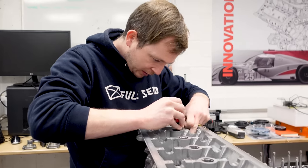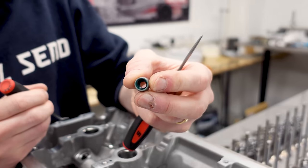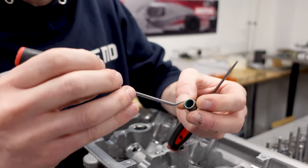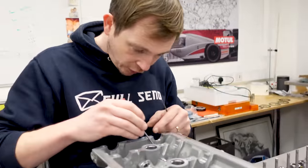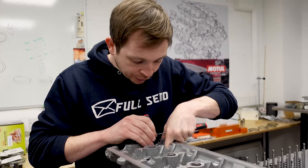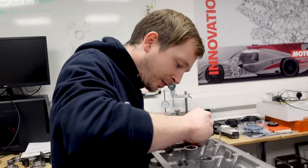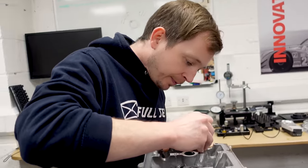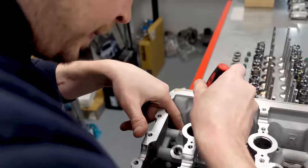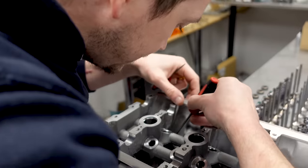What the guide has pulled off here - you see the ribs on the inside. As you've pulled them off, it's like a lip on the edge of the guide that pushes down over these ribs. As we pulled the seals off it's torn those little lips out of the inside of the seal. They always do it when they come off - it's part of the retention mechanism that holds the seals onto the guides. You've just got to make sure you get them all out.